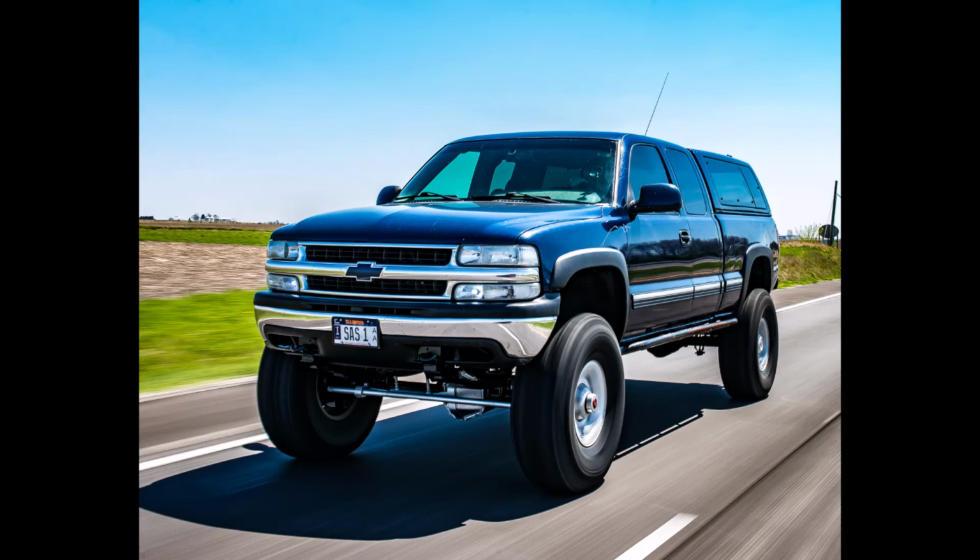Anyway, something got lodged in between the transmission cross member and the transmission, dented the pan and broke the shift solenoids. It wouldn't shift out of second gear. Mike was riding with me, and I was trying to show him all the cool stuff the doubler does, trying to do front digs and whatnot. I said it seems low on power, and then we realized it was stuck in second. I drove up and down the street, it wouldn't shift out of second, so I pulled the pan, and both of those shift solenoids were broken.